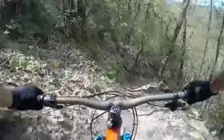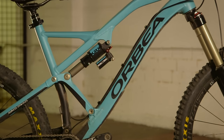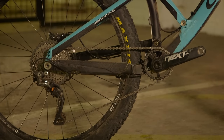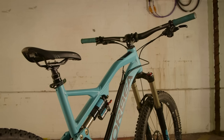You should never judge a bike just on paper — we've definitely learned that with this test. The Kona and the Orange might have been our personal favourites, but what about the other bikes? The Orbea Rallon X Team is more of an enduro bike so it did pedal better than some of the others. However, we found the rear suspension was perhaps a little trapdoor — it felt very easy for it to go through a lot of its travel. The spec is very good: Bos forks, Bos shock, XTR drivetrain. But the geometry, while looking good on paper, is actually pretty tall — the seat tube is more like an XL bike while the top tube and reach is more like a smallish large, so it didn't feel quite right.